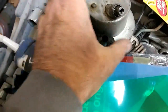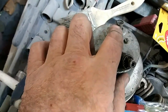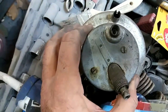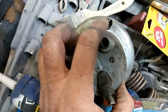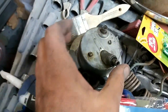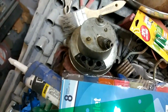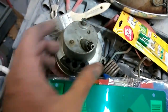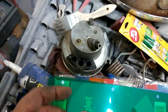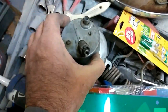If it's not working good, I'll take it apart and actually re-grease it. It's a little bit involved — you have to slide your screwdriver around here, take the ring off, pull the glass off, take these two screws out, and then kind of wiggle your way out. This piece kind of has to wiggle its way past the bright light indicator to get it off. You take it apart, take this apparatus off, grease it, and then it usually breaks and you have to glue it back on.